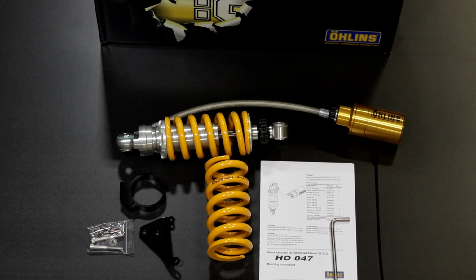This has two springs, as you can see, included with the kit, along with all the mounting hardware, stainless hardware, aluminum clamp and bracket, and a nice stainless spanner wrench. No more of those double lock nut spanners for the spring preload. Now it's just one. It's got a little nylon insert that you can loosen that holds it on the threads from rotating when you are set and done. And you loosen the nylon nut, and you can use that little stainless spanner wrench to rotate and increase your spring preload on that shock.